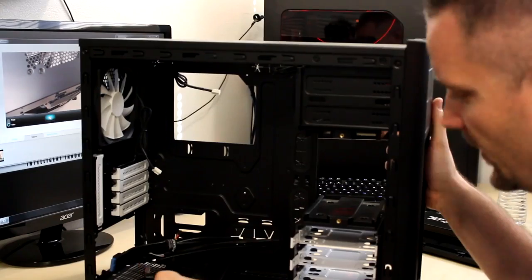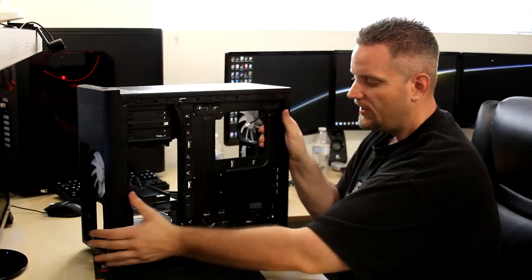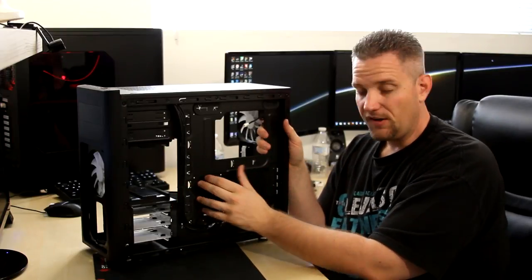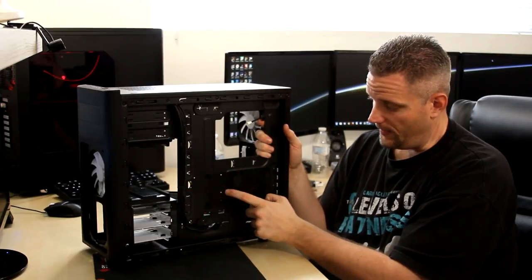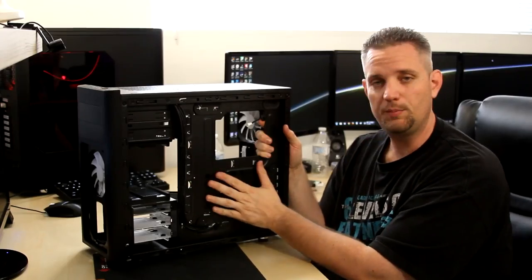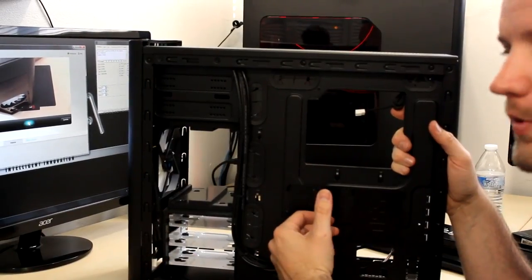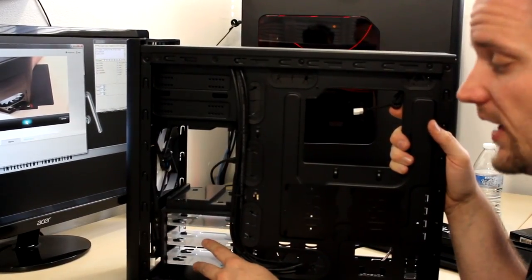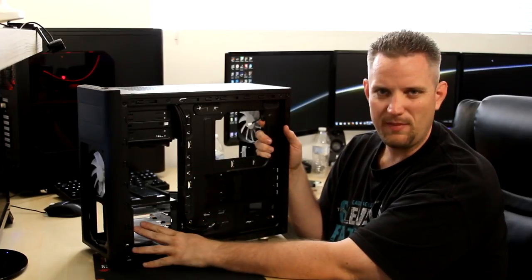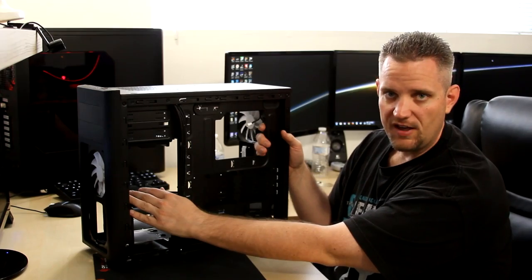On this case you can also install your SSDs on the back, so you need to decide whether you're going to install them there or on the drive cages. Draxon decided to put the SSDs on the back hidden. Since he'll probably want to put some mechanical drives in later, we're going to leave the front cage in and take the top cage out for maximum airflow.